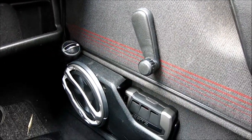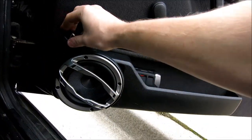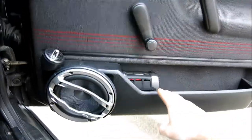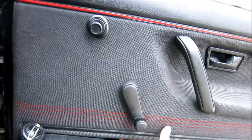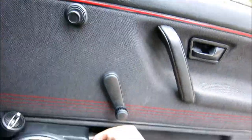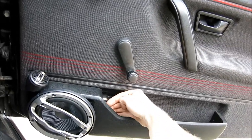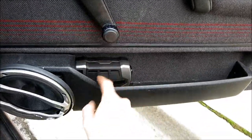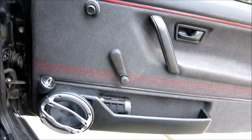I'm going to copy the other side and open up the door. There you go — that's it. Nice and sealed up here. Got to probably seat that tweeter a little bit lower, but I've got it screwed in here. All the wiring's right here, and there it is. It kind of looks really cool and it's sealed in the door. This even covers it a little bit from the rain. You could even make a little hood if you wanted to. With the way this is, this was like perfect right there, and there's no vents up top — they're all on the side anyway. So it'll help keep any water out and stuff like that.